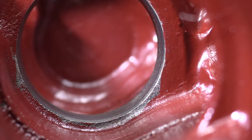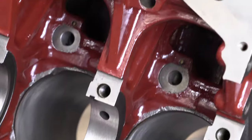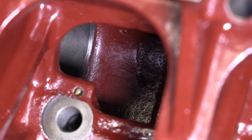Aside from the fact that I already don't have the left shaft bearing, with a balanced shaft delete, you don't even need to mess with the left shaft bearing at all. That bearing has no oil hole, and it doesn't hurt anyone just to leave it in there forever and never mess with it. I mean, I suppose you could remove it for weight reduction, maybe.